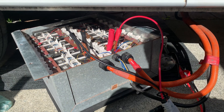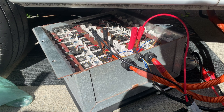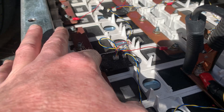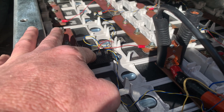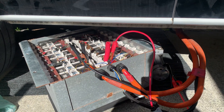I think the battery movement is going to have to be addressed in future. That does mean removing all the batteries, and at that point we'll probably replace the battery management system as well — put a more modern Batrium system in that's less dependent on the Blockmons to discharge the battery, with a more centralized system. With the newer system we'd actually be able to see every single battery's state even if it were dead flat.